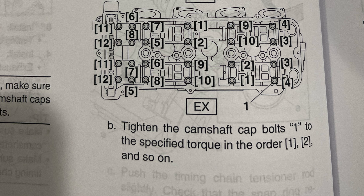After we put those in, we're going to put the camshaft caps back on and tighten that down in the order of the torque sequence, but we're not going to torque it just yet. We want to get them evenly dialed and seated on the cylinder head, and then we'll come back and torque it afterwards.